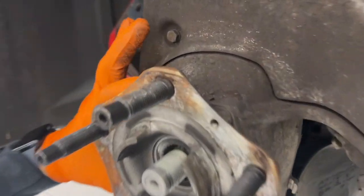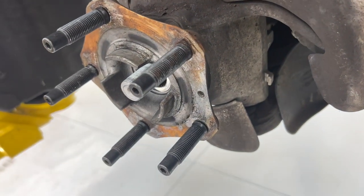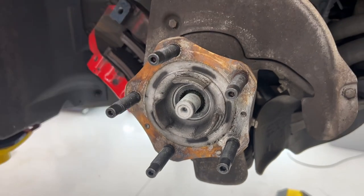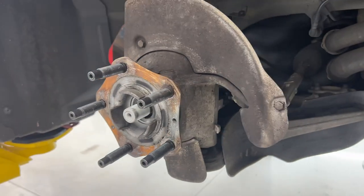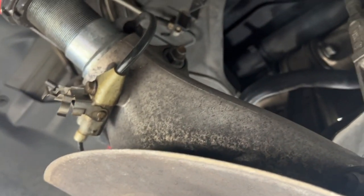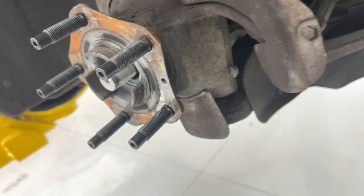There's a captive plate that holds the bearing inside of the knuckle. And I believe there are four bolts. Yes, I see them. And we'll need to loosen those so that when we're gonna use a slide hammer to pull. And as we pull, we're gonna try to remove the hub out before we remove the bearing. All right. Everything at once, because the other option is to remove the whole wheel carrier and use a press to press it out. That's actually what the manual shows.